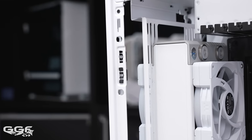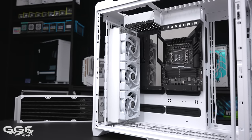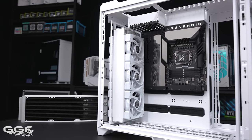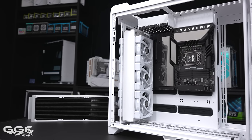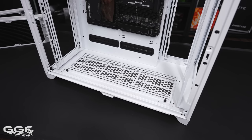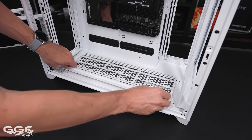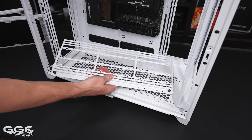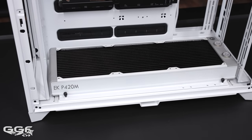360 radiator support here is much better, as being shorter, we don't have to worry about the PCI module at the top, and we can see with this EKX360M 60mm thick radiator clears with the PCI module in its default position, even with a push-pull config. The bottom radiator location is tricky and will heavily depend on the other radiators being used at the front and rear of the chassis. This bracket is removable and supports up to a 420, and this EK P420M fits fine,